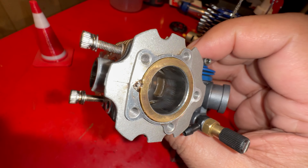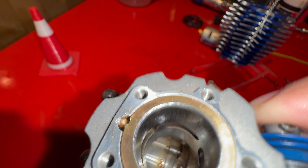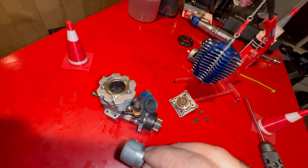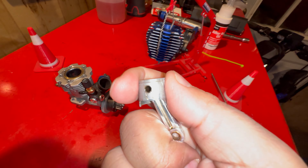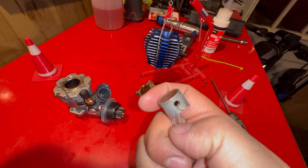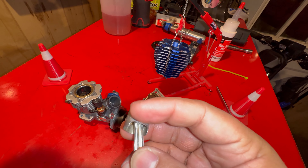The scoring — those light marks are normal — but there are serious cuts inside. You can see those three lines right there; the camera doesn't pick it up well but it's really serious damage. The piston has serious damage that will cause a serious loss of compression. The connecting rod also has play in it — it's wobbly — there's play between the pin and the piston. I could reuse the rod but I'm not going to.